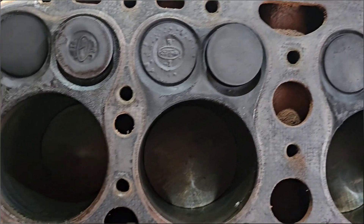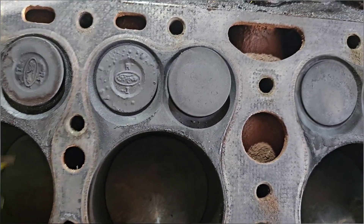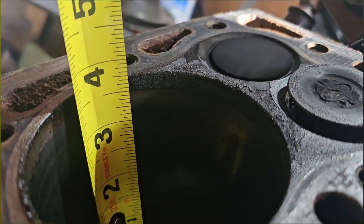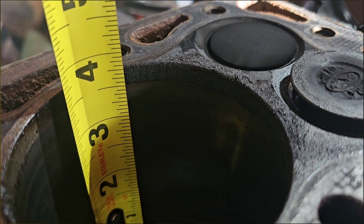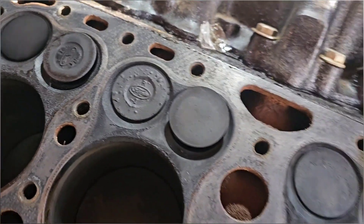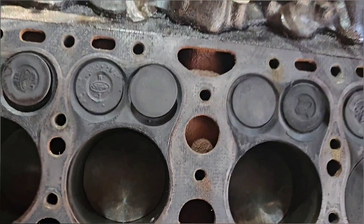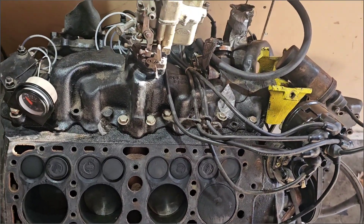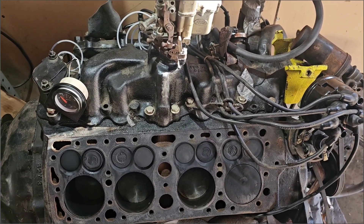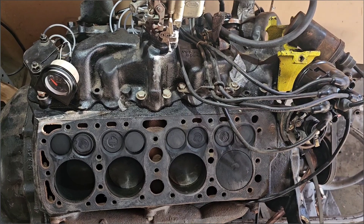I've got number four back here all the way down. This is an incredibly rough measurement, but it's good enough to give us an idea of what's there. It's three and three-quarter. So we have a Ford, which doesn't surprise me. It would have been nice if it was a four-inch Mercury crank, but it is not. And really, that's about the only way — without taking the pan off — you can determine whether your flathead is a Ford or a Mercury. Either way, the little engine runs so good that it's going in the car regardless.